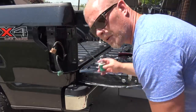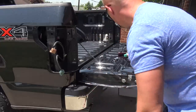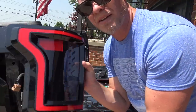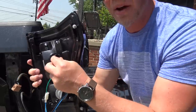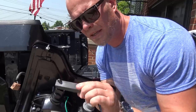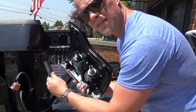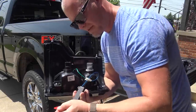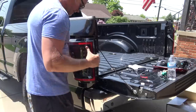Now a slight correction — you don't, of course, have to take the bulbs out. You can just remove the connector anyhow, but I don't know why I did that. So then we move on to the ANSO LED taillight and installing that, of course. Everything is already pre-wired — you have everything you need here. It's just plug and play. Now you'll also see that it comes with a resistor. This is to correct the rate of flash, and it's going to be stuck to the vehicle. So we're just going to remove the protective tape, stick it on there, press it for a few seconds, and then plug and play.